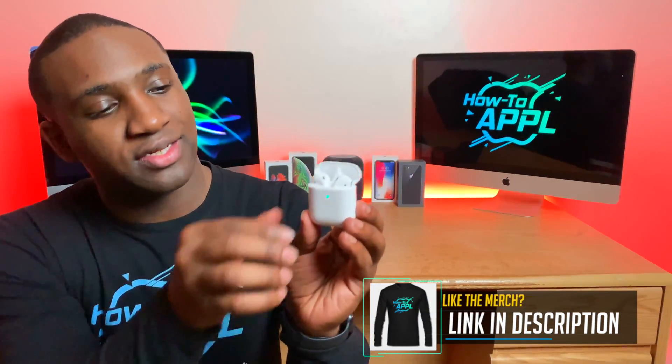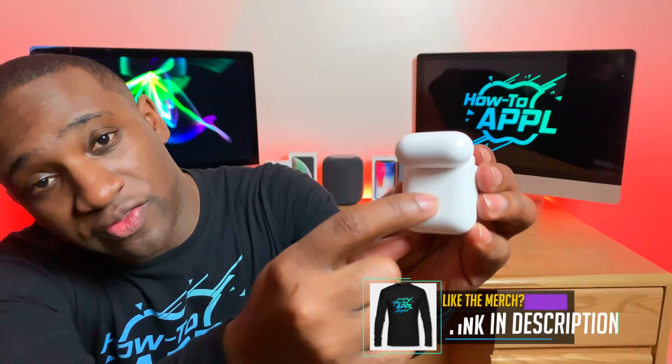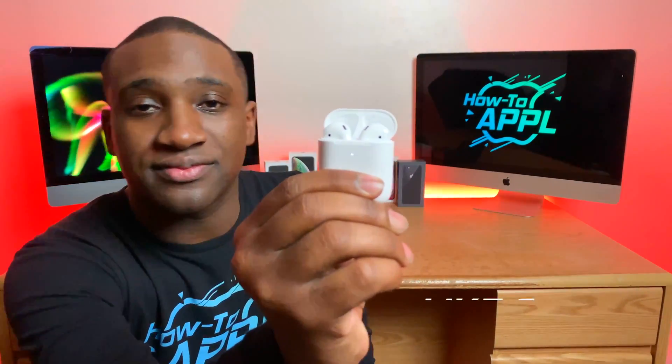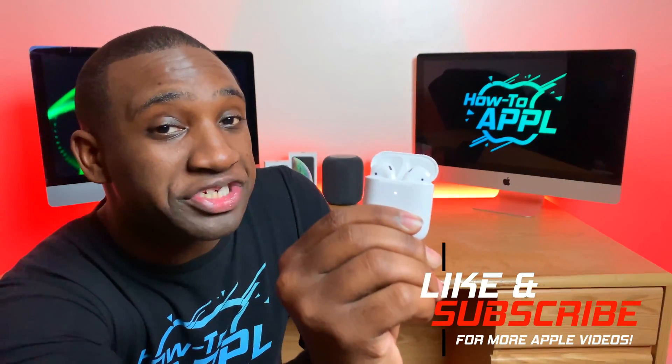So now I'm going to show you how to reset these, and it's very easy. To reset your AirPods, you're going to find a little light in the front — yours may be on the inside if you have the first generation. Go ahead and open them up, you'll see that green light, and then push and hold the button on the back. Your light will begin to flash, and you're going to wait for it to flash orange — once it starts flashing orange, you'll know that they are reset.